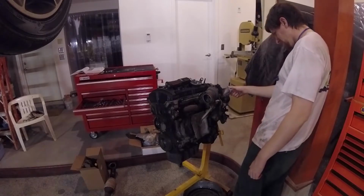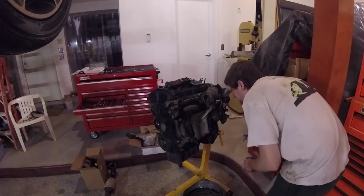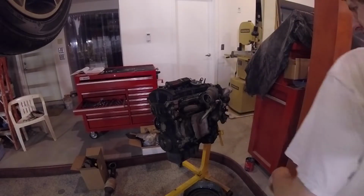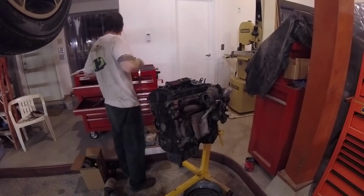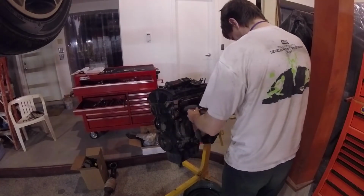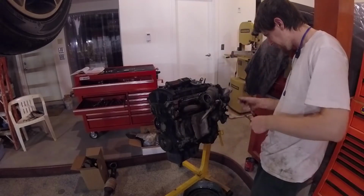Yeah, we gotta reshuffle the camera around a little bit. One side of this turbo housing is going to stay with the car. We'll see that towards the end here. But that is me marking the wastegate arm as to where the nuts are. That way it can go back in close to the initial position and not foul anything up or have minimal issues when everything goes back together. Just a little bit of silver Sharpie. That way you can get the position right.